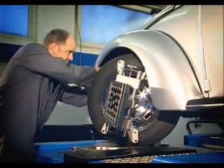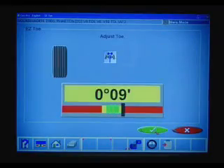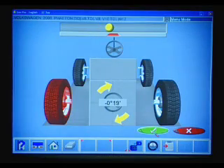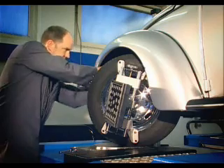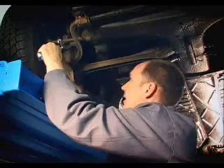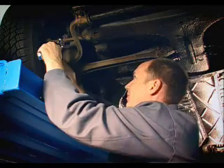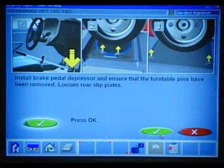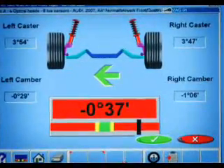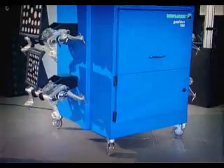On some vehicles, it is very difficult to make adjustments in the wheel housing. Easy-toe permits adjustments to be performed simply and conveniently at the maximum steering angle. Time-consuming adjustments in the wheel housing are a thing of the past. Engine cradle adjustment is lengthy and complicated and prone to errors. Here too, the 3D aligner software assists the user by guiding him step-by-step through this previously time-consuming process. Errors are avoided. Cradle adjustment is carried out quickly and efficiently.